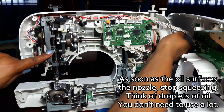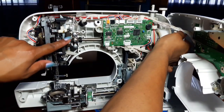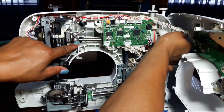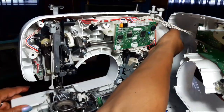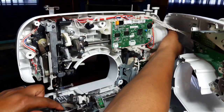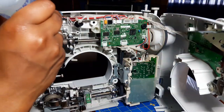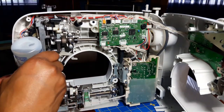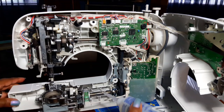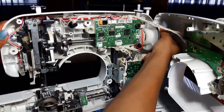So how do you know what to oil? Using your hand wheel, turn it a couple of times slowly. Anything that has a joint, a pulley, or is moving will need oil on it. Make sure you clean those areas with your paint brush or cotton swab before oiling, because we don't want gunk mixed in with the oil. We want nice clean joints so all our parts stay moving and working.